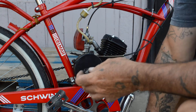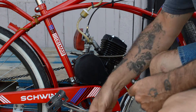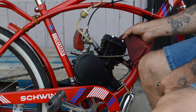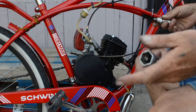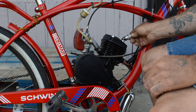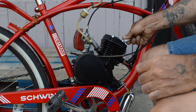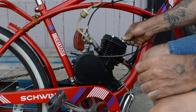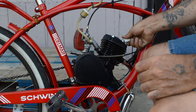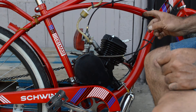After you get it clean and re-gapped, take your rag and make sure you don't have any debris that's going to fall in the hole and mess up the spark — or worse, burn a hole in the top of your piston. When you thread it back in, do it by hand, make sure you line it up and screw it right in. If it doesn't go, you don't have it on the right line. Screw it all the way in until the washer makes contact with the cylinder head — snug fit.